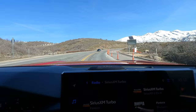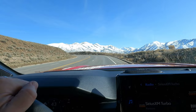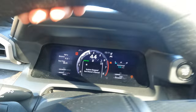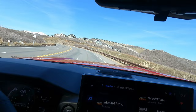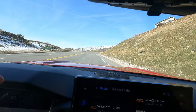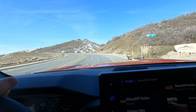Speed limit is 40 — it used to be 45. That speed tends to be right in between gears for a lot of vehicles. This one — 317 foot-pounds of torque, 284 horsepower — look at this thing, it's just chilling. I did have to downshift right there with the 8-speed automatic. The Ford's 10-speed I have issues with; GM does a little better with the 10-speed. But 8-speed seems to be kind of the sweet spot. With a 6-speed you're missing out on a little range — the gears spread quite a bit at the top. But on the 8-speed, it fills in those gaps quite nicely.